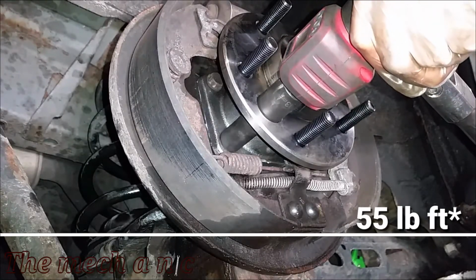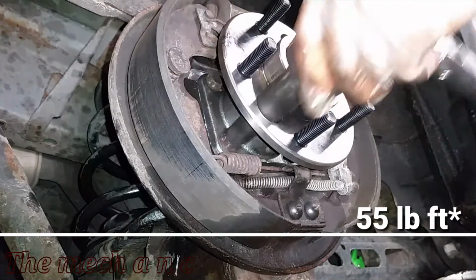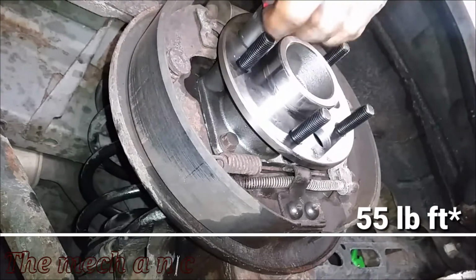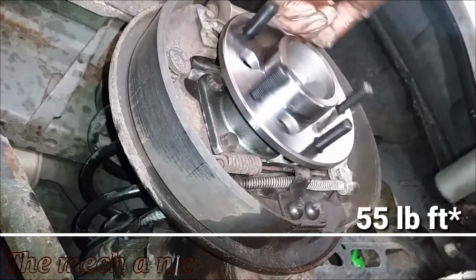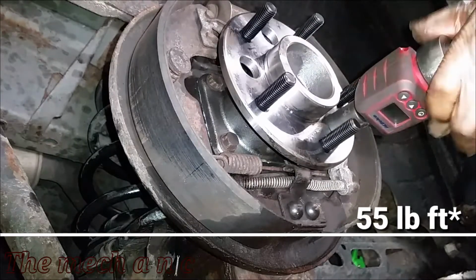At that point, all 4 fasteners torqued down nice and even, and I didn't feel like there was any possibility to pull any threads at 55 foot-pounds. But I do encourage you to go out and do your own research and try to find these torque specs for this wheel bearing. If you do manage to find something, please leave a comment below, and that way I could pin the comment and share it with everyone else.